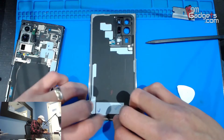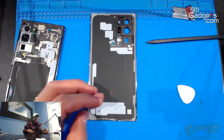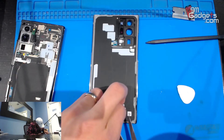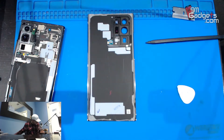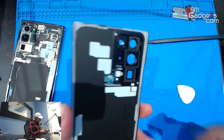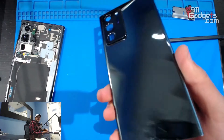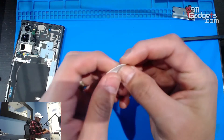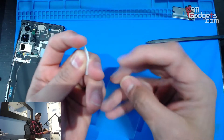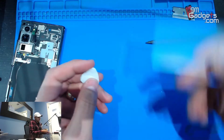Let's put it aside as much as we can, and we're going to cut the rest of the adhesive. There it is — we just cut that little excess adhesive, and we can reuse it again as long as there's no bulkiness. It's still sticky. We got this off without breaking it — it's a challenge, just make sure you use enough heat. I'm using the tip of this pick. I'll do a video testing the other one.